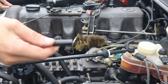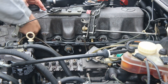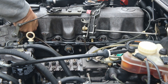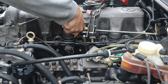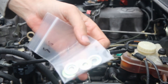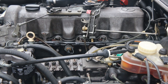We're going to use a brass brush to clean out these prechambers, just to make sure there's nothing wrong down in there. It's very important to use brass on any part of this that you're going to try and clean, because we don't want to leave big scoring marks in anything. Then we're going to add our brand new injector sealing ring — the tapered side goes down and this side goes up. We're going to set those down in there and make sure they sit in nice and flat.